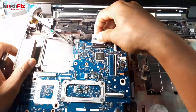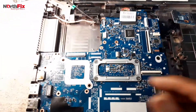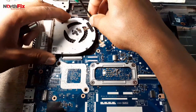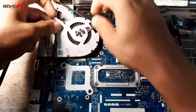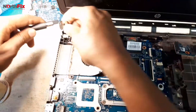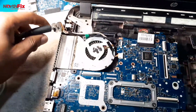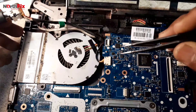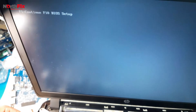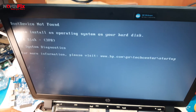Let's test this on the display. Connecting the LVDS cable. Let's wait for the DC jack LED to flick — yes. Using a tweezers to trigger the power button on pin number 1 and pin 3. Yes — the machine is on, the laptop is on and it's working fine. As you can see, everything is good.